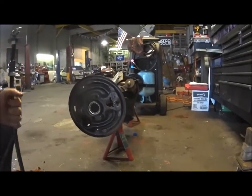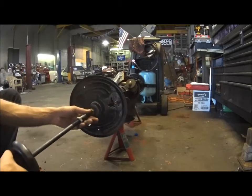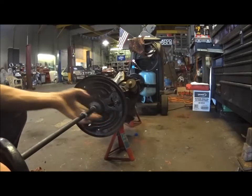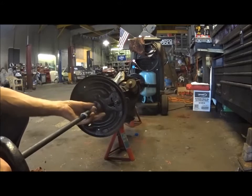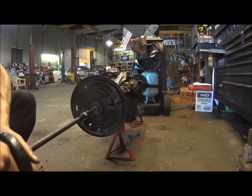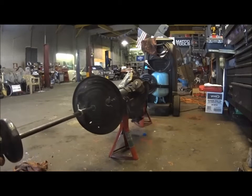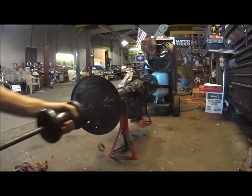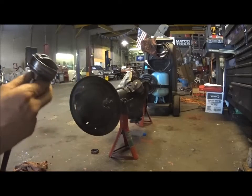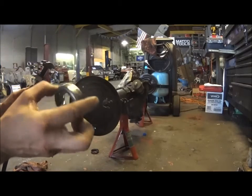Here on our old bearing, you're going to unscrew this thing so you have enough to get this thing inside. You can pull - put pressure against it, and then you can feel it's flush in there. You want this to go flat. You can tighten these hand tight from experience - you don't really have to kill them. Just make sure it's tight and start pulling it off. That's it - three shots, and there's your old bearing.